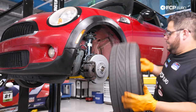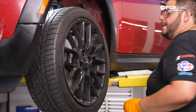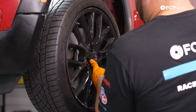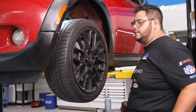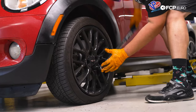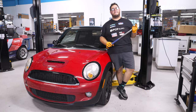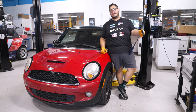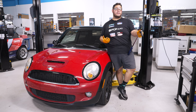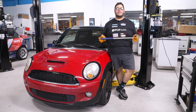Now we go ahead and throw the wheel back on, lining up the lug bolt holes. We use the impact to snug them up evenly so the face of the wheel is even to the face of the disc, then lower it down and torque properly. With the car on the ground, we torque the lug bolts down. And that's going to conclude this DIY. Overall, a really easy and straightforward job on the R56 — the steps are the same for non-S vehicles as well. If you liked this video, give it a thumbs up, leave questions in the comments, and consider subscribing. Thank you so much for watching — we'll catch you in the next one.